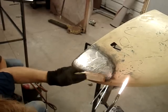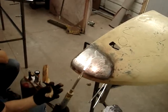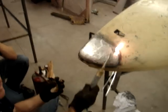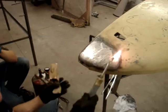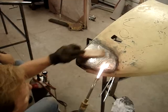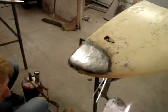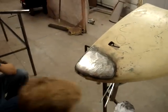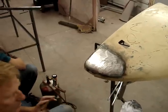What happens if I take that cold lacquer thinner and just mash it on there is it crystallizes the lead. The lead will actually literally shatter, and then it creates all of this place for contaminants and crust. I want to be able to clean this off while the tallow is still soft.